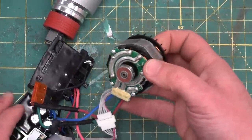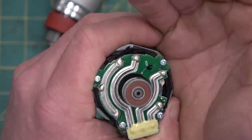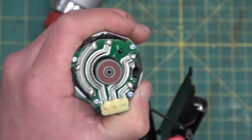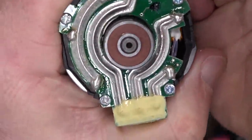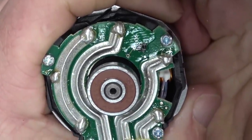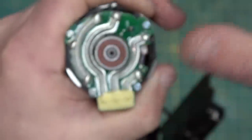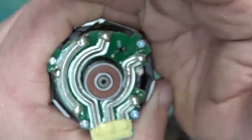If you look at the backside here, look at the amount of copper, or rather solder, that they've wave soldered on there somehow. Unless that's a wire. It might be a copper wire. Oh, that's interesting now. Let's have a look at that. Oh yeah, very cute. That conductor is copper wire. So it'd be a non-magnet wire, just no insulation on it at all, and then affixed to the board. And then of course they would wave solder this. See all of the solder that's been applied there.